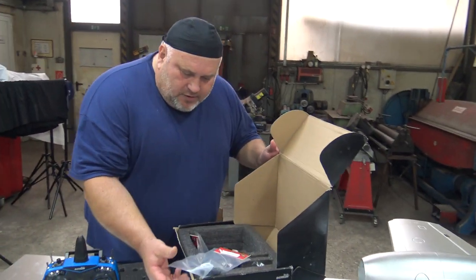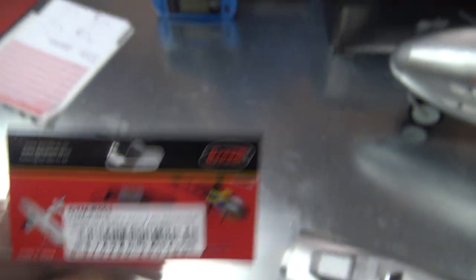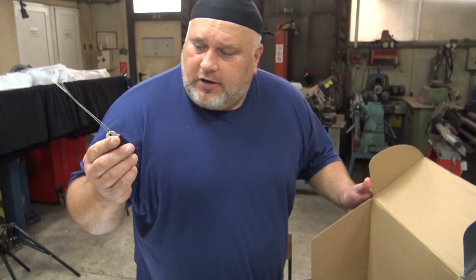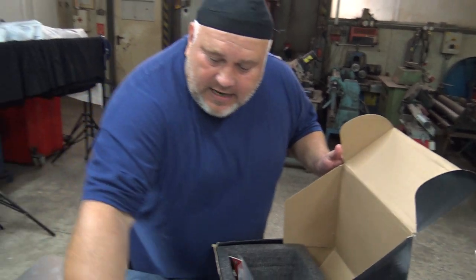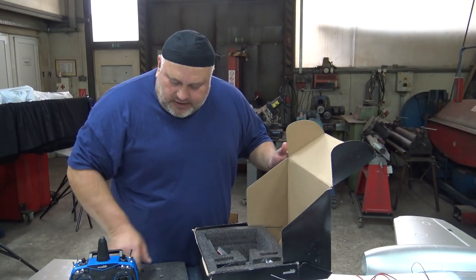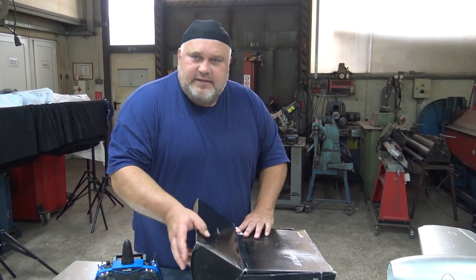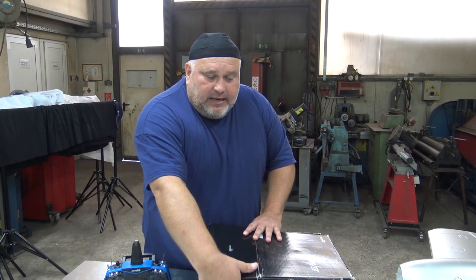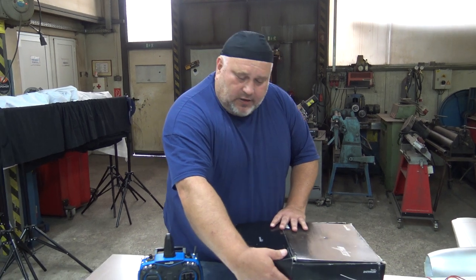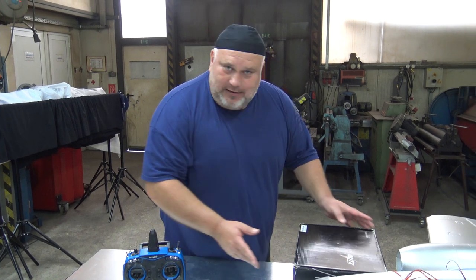You must check: it says on the iStone receiver. The iStone receivers come with the gyro. You have this 8-channel, and you also have a beautiful 6-channel with the short antennas. Even with short antennas, I made the test — I was flying the plane so far away I could barely see it, and they still work. Even with short antennas, you have more than 1.6 km of range, or one mile. That is pretty cool.